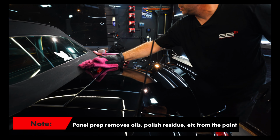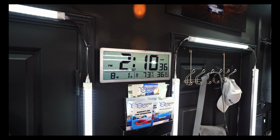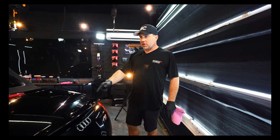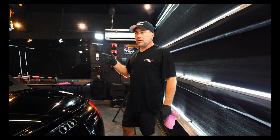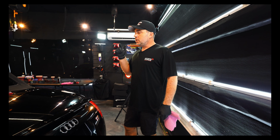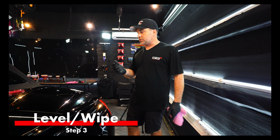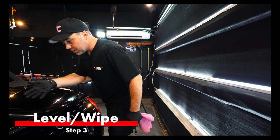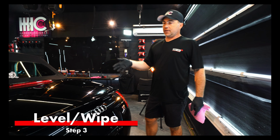All right, so we're at about a minute, and I'm just going to explain something real quick while I wait this last bit. Your conditions of the shop will vary. Right now we're at 72 degrees and 37% humidity. So we have enough time where we could probably do multiple panels at a time. But if you're in a humid climate or a hot climate, you may not have that time. So the 60 to 90 seconds up to 2 minutes for flash is a guideline, but really you just need to be smart about it and look to see if you see the rainbow effect if you're in one of those types of climates.